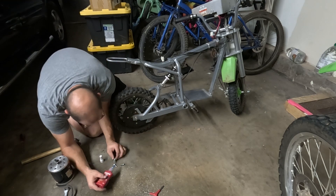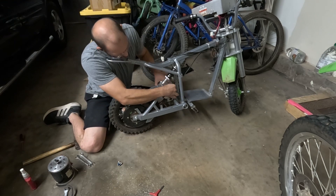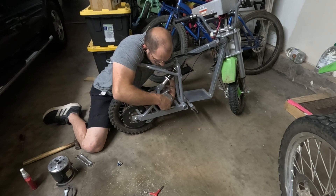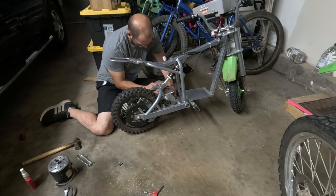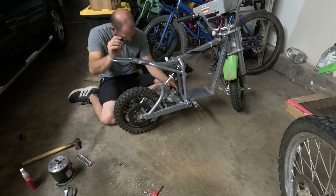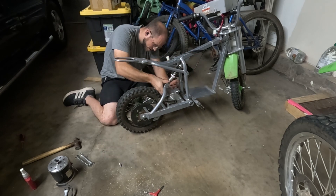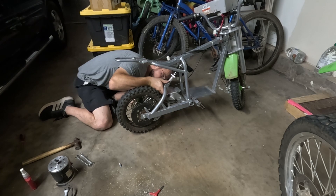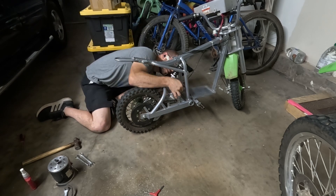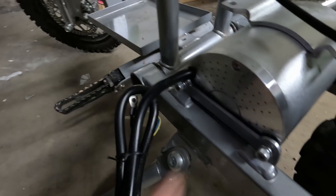What we're doing is we're actually waiting for the batteries to come, so we're doing everything prior to that. We're getting the 1800 watt 48 volt motor connected, putting on the handle with the new throttle, and we're also gonna swap out the power connector for the controller to an XT-90 so we don't have any sparking when we plug it in. We're really never gonna unplug it again, so you don't really need the XT-90 — you could use a Dean's connector if you wanted to — but I've got them so that's what I'm gonna use.